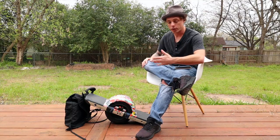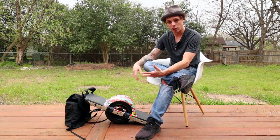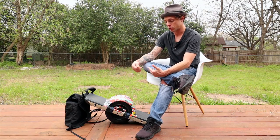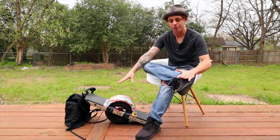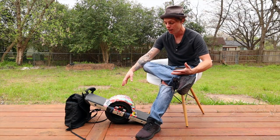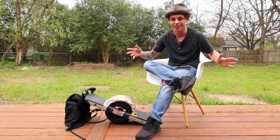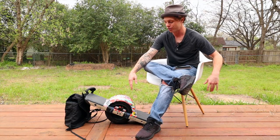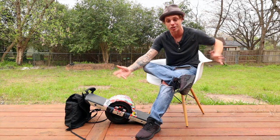One more thing to note when charging: when it reaches 100%, the board does not turn off like it normally would on just the internal battery. There is a BMS, so I don't think it'll really damage anything, but I just pay attention and disconnect it within a few minutes of hitting 100%. Overall, I absolutely love my Pint even more now with the extended battery and definitely recommend it. I'm going to try the fender mount in the future, but right now I'm really liking the backpack mount. When I did nosedive, the quick disconnect worked perfectly — it just disconnected, no issue at all. If you have any questions, drop them in the comments below, and like and subscribe for more!